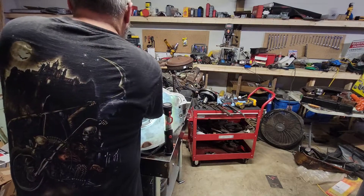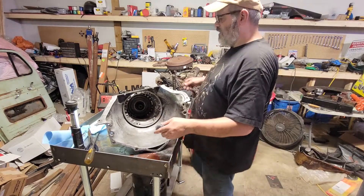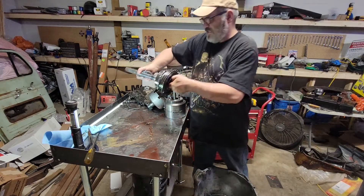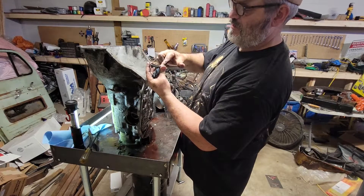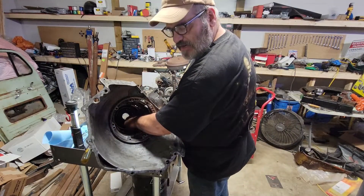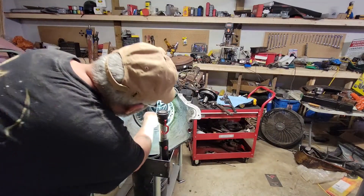What'll happen here is sometimes this will rotate in and lock, and then you got to beat it to get it out. So when it comes to getting that out, easiest thing I know how to do is take your case and slam it on the ground — just like that. There we got a little roller bearing that sits in the back — it's got a little flange; flange goes down, so outwards. The last piston in the back you definitely want to pull out — it's spring loaded and there's a clip in there you got to pull out. They sell a tool that locks in and you turn it, putting pressure on that spring. That's the last hard thing to get out.